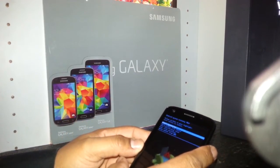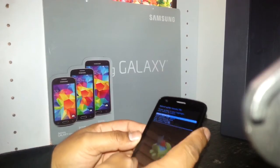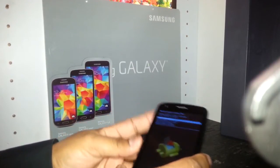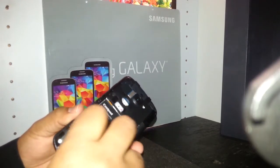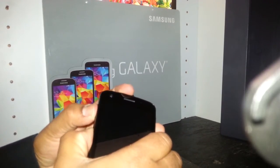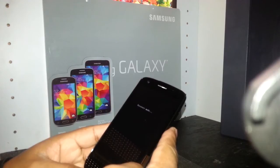You will see the menu with the blue letters. If it didn't work, please remove your battery and restart the same process. To recap: power off the phone, press volume down, volume up, and the power key. The Coolpad logo will come up — keep pressing until recovery mode appears, then release the three buttons and wait for Android recovery mode to appear.